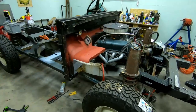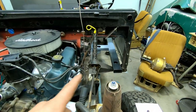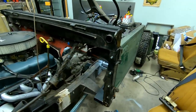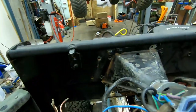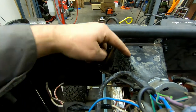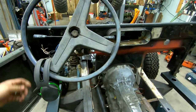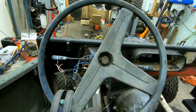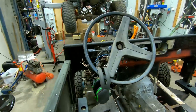I've mounted the bulkhead again and done a bit of measuring. The steering column is where it's supposed to be — I moved it. One stud broke, of course. So I moved it 30 millimeters over that way, so now the steering wheel is in the center of the seat position, which makes it a bit more comfortable to drive. Leaning over to the steering wheel is not fun.